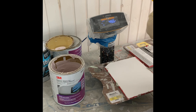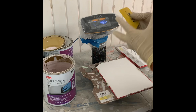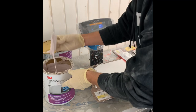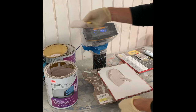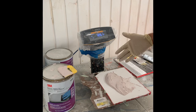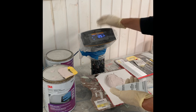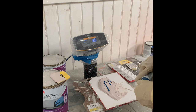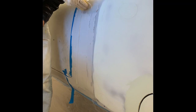When we mix filler, it's critical to weigh it — especially on a high-end car, you want to keep things as uniform as possible. We're going to mix it 50 to 1, which is 2 percent hardener. We're using 3M Platinum Select — I like the way it spreads. I've got 125 grams of filler on here, so at 50 to 1 that would be 2.5 grams of hardener. That is the proper mix for filler.